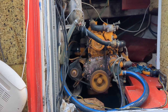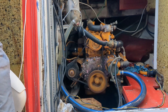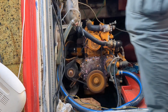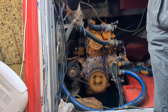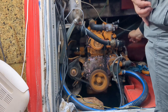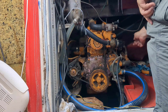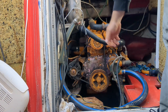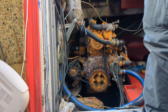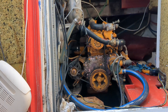It seems that the problem with starting Ophelia's engine was down to a two-fold compounding issue. One was the short circuit through the alternator, which seems to be broken and either has a dead diode, an internal short, or both. The other was that with the heating enabled on a less-than-maxed-out battery, there just wasn't enough power to turn the engine over. The heating coils start out by drawing quite a bit of power, but as they get hot their resistance increases and their power draw drops. So with a fully charged battery the engine can then start. However, the power bypassing the heating coils through the short meant that the coils didn't get hot enough for the power draw to drop, leaving too little juice for the starter to actually turn the engine.